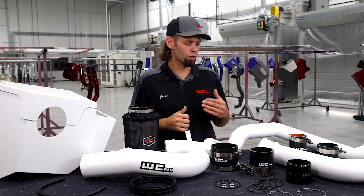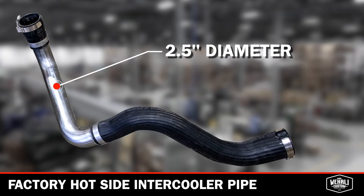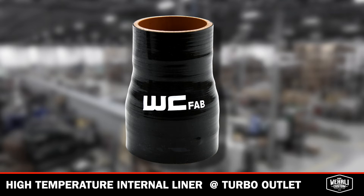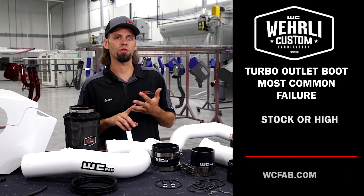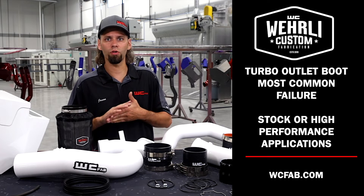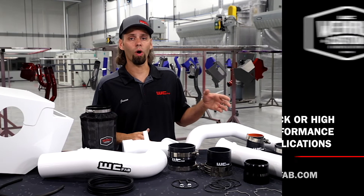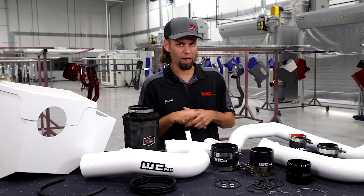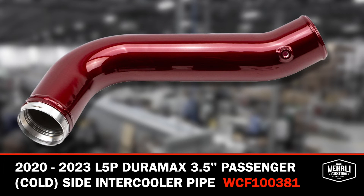Leaving the inlet side of the turbocharger, we go into the intercooler pipes. Out of the turbo we have our 3-inch High Flow pipe, larger than factory — the factory unit is 2-piece and right around 2.5 inches. We use a high temperature rated silicone boot at the outlet of the turbocharger, and we also have wire reinforcement internally in these boots to eliminate the chances of the boots blowing. The turbo outlet is your number one most common boot to fail, whether it's a stock truck or a higher horsepower application. The wire reinforcement eliminates the boot from being able to expand and tear open. That boot connects to our high flow mandrel bent intercooler pipe — 14-gauge heavy-duty aluminum.